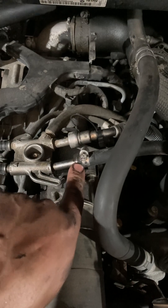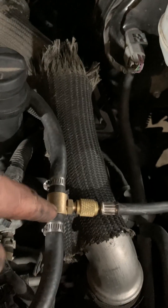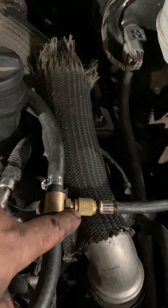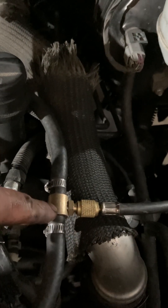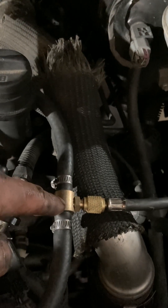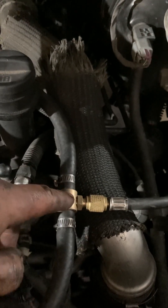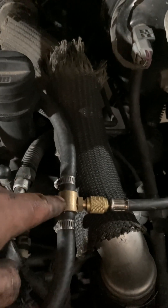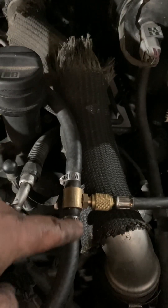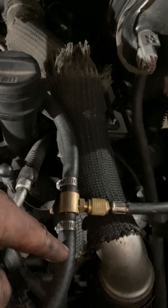I have this 3/8" line fuel hose connected here to a brass T-fitting with a Schrader valve to hook your fuel pressure gauge to. This is in any inexpensive fuel pressure testing kit on Amazon or eBay — $25 to $35 kits include this fitting, which has two long 3/8" barbs on both sides to hook the hose to.